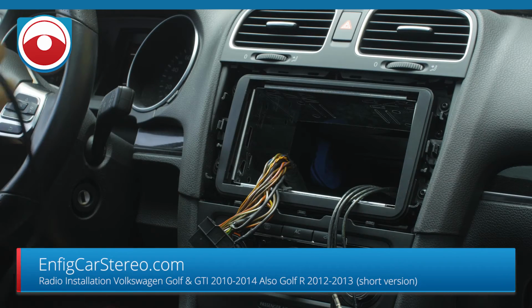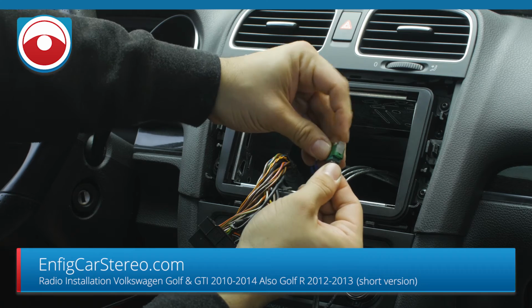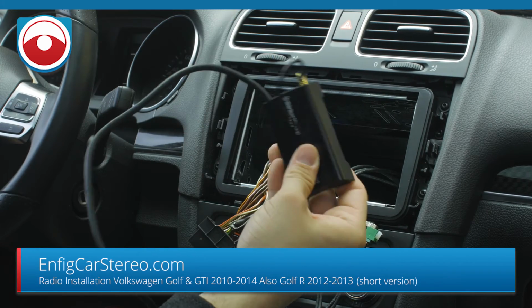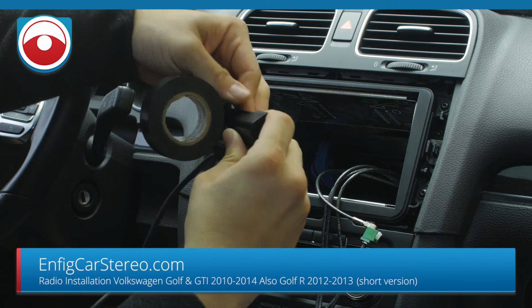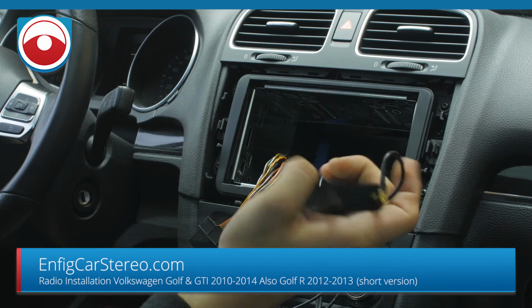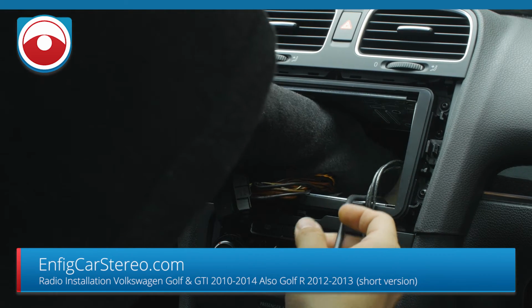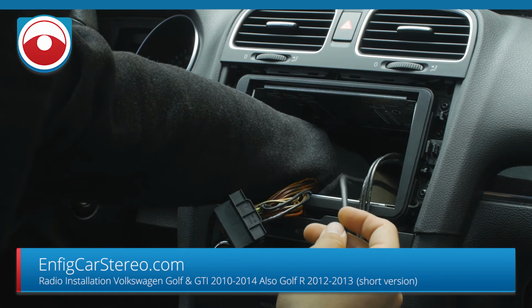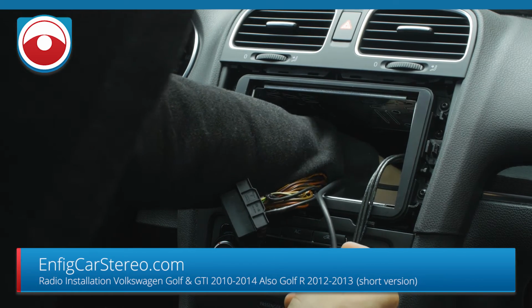First thing we're going to do is the Sirius XM antenna. So we're just going to plug that into the factory antenna. Boom. Boom. This is at pretty much real time. We're going to put a little tape around here to keep it from pulling out while you're back there. All right. And then we're just going to take this antenna and just tuck this back here. I usually put it between harnesses, so that way it doesn't rattle around. You just jam it. Actually, what the hell? The rubber band back there. There it is.